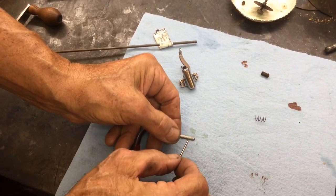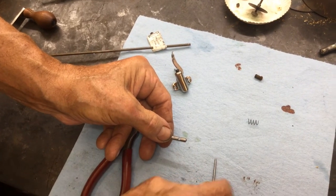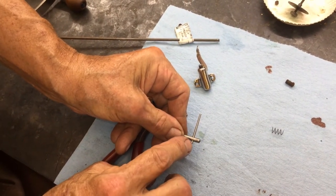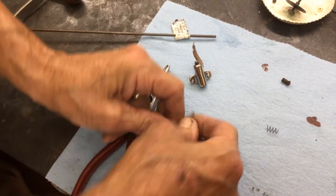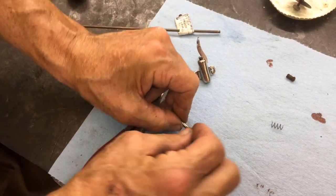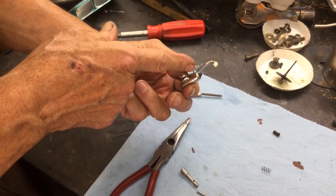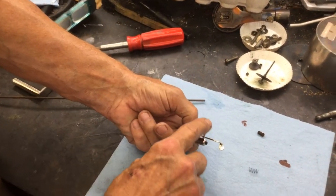What I do, because there's no material on each side to drill a bigger hole, I use a tapered pin that I modify. I push this in here, then I cut the big end down to where it barely fits into the hole. Then I reverse it, because I'm going to shove it through that end and tap it down like I've done on this one. Now all I have to do is cut and trim it down to fit.